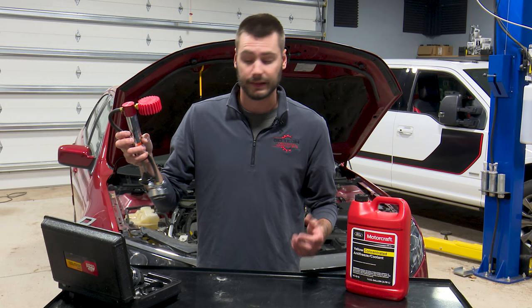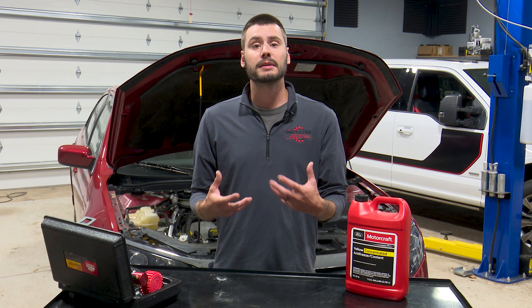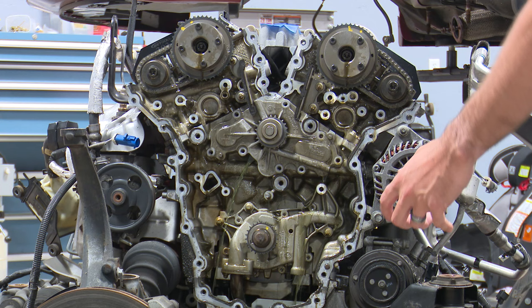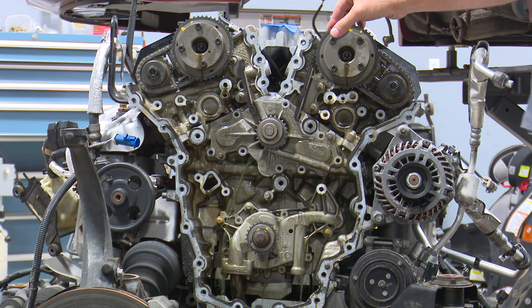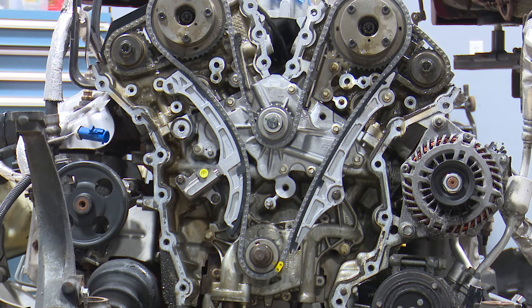One of the areas that is commonly overlooked is the ability for coolant to leak into the crankcase — meaning the coolant is leaking into where the oil would be sitting in the engine, which can mix with the oil and cause an overfull condition. What causes that typically is a water pump starting to fail. On this 3.5 liter and many other engines that are timing chain driven today, they run a water pump that's driven by that timing chain, and that timing chain is sitting within the oiling system of the engine.